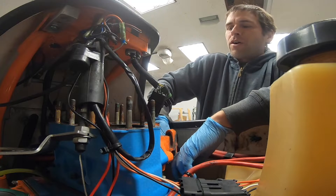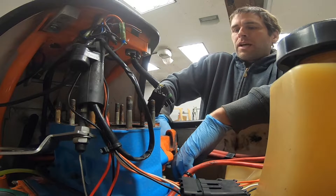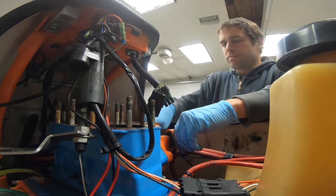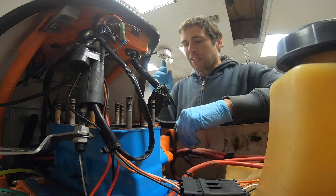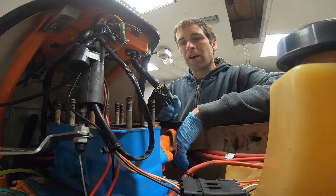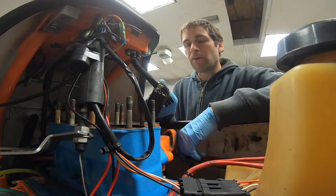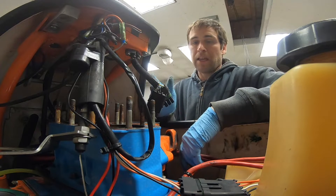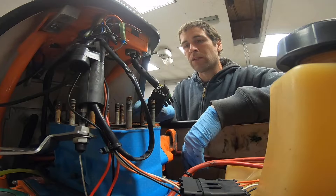I think this is a really good argument for running a dual cooling system — running one of the cooling lines so that it only cools the engine, and then another one for the exhaust specifically. That way you have two different pissers coming out at the front: one indicates whether or not you have flow through your engine, and the other indicates whether or not you have flow through your exhaust. If I would have had it the other way, I would have known that I had a leak in my head — basically between compression and the cooling jackets.